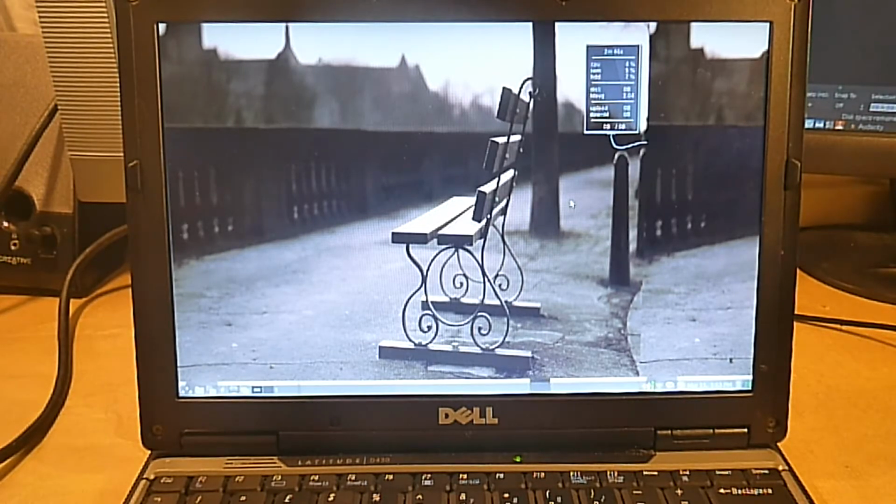Still, this operating system is out of date, so I'm going to put a new one on anyway. But for now, that's finished. Took a laptop with a broken screen, which turned out to be the backlight, and changed it with the backlight from another broken screen, and together we made one good one.